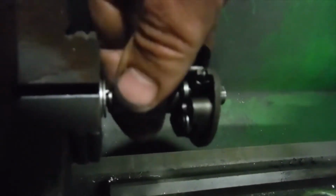So we've got to get something else in there spinning straight and true, or we're going to have to put the electronic ignition on there. But this is obviously faulty. It advances okay, the bob weights and everything, the springs work fine, no problem with them, but because of that throw, it's all totally out of phase and out of step with what it should be doing, and there doesn't seem to be any way of correcting it.